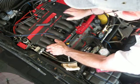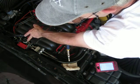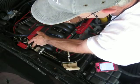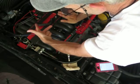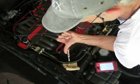Your return line is usually going to be the one coming off of the fuel pressure regulator. The feed line, here you can see on mine, is the line that tees off into the two fuel rails, and then it feeds the rails and the injectors, comes to the fuel pressure regulator, and then out and back to the tank.